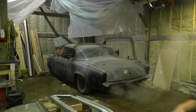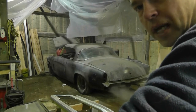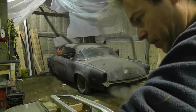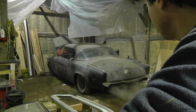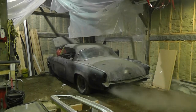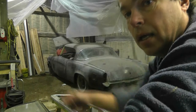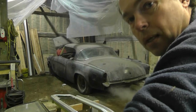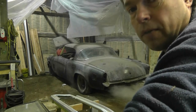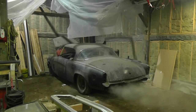Now it's smoking. I know it needs a carb kit because you can hear the hesitation — the accelerator pump is gone, assuming that carb has an accelerator pump. Anyway, what I'm trying to do is move this thing around that way and get it out of the way so I can bring the 4x4 forward, and then maybe bring the F-350 in here and work on it as well.